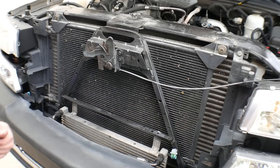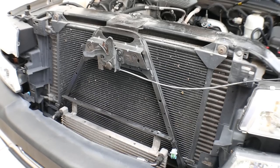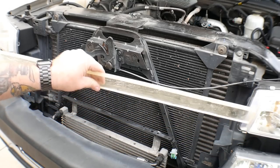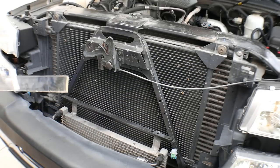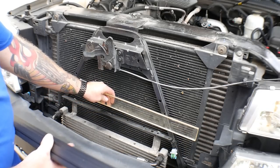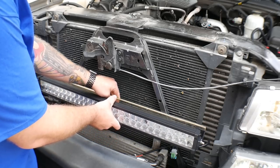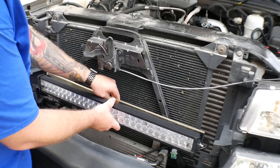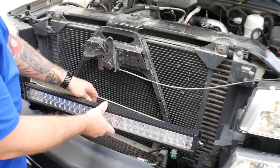We're going to need to make something that goes 32 inches across, and I found an old piece of plexiglass in my garage. I'm going to use that because it's easier to work with — it's still stiff and rigid. I know a lot of guys are going to knock me for not using steel or aluminum, but it's what I have available. The plexiglass is three-quarters of an inch thick, so it's heavy duty. I'm going to use some self-tappers to put a couple in each side, and the light bar is going to fit right there, still giving me plenty of airflow to my radiator and condenser.